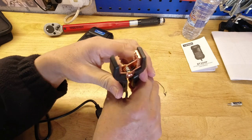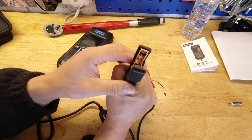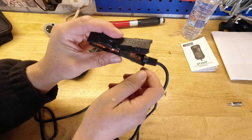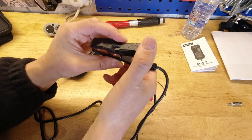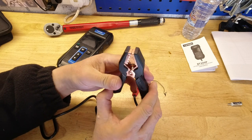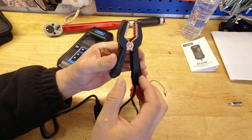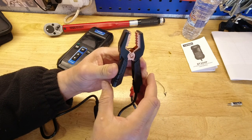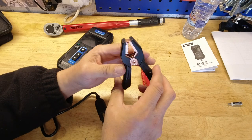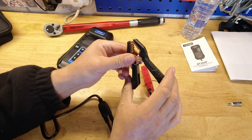If you open the jaws, you'll notice there's a wire that connects both jaws together. With the majority of croc clips — even on decent battery chargers — only one leg is positively connected to the cable; the other just relies on the hinge or spring. These have an interconnecting wire to ensure really good connection on both sides. All bodes well, and nicely insulated.